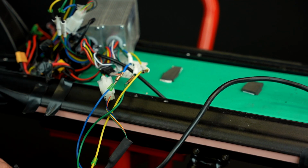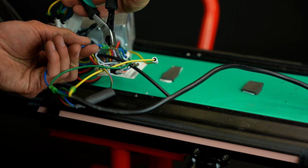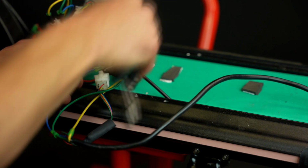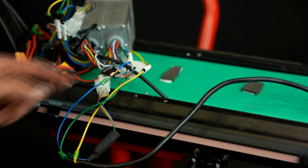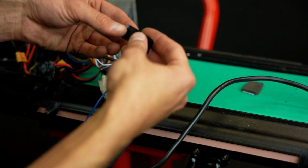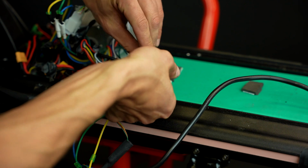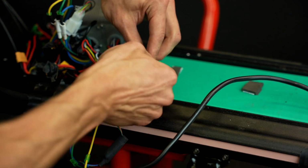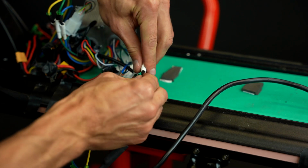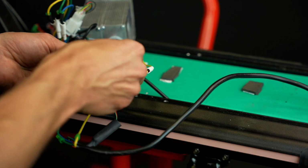Next, cut 3 pieces of electrical tape. Now give all 3 colored connectors a gentle squeeze with your pliers. For safety reasons, you should cover all 3 connectors with electrical tape. Be sure to completely cover all these connectors, none of them should be left exposed. Now move the white rubber covers exactly to the middle of the wire connectors, like we have here.